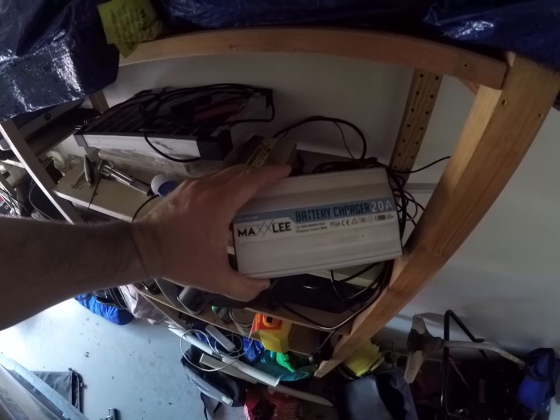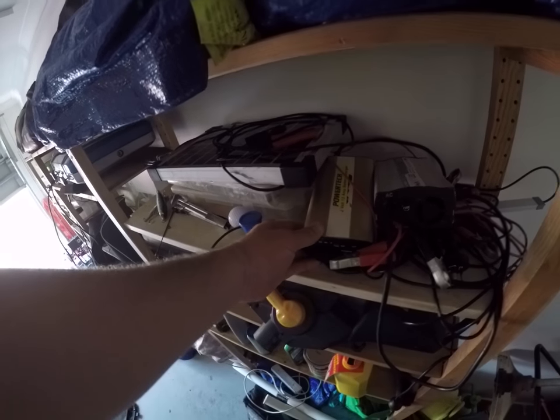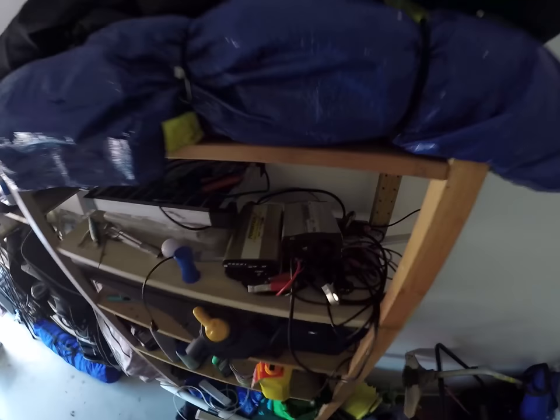I want a long, slow, easy-going charge that's not going to blow my battery. I found if I try to pump 20 amps through sealed batteries they don't last - I get a year or two out of them, they swell up. For my maintenance-style battery that can ventilate, I pump 20 amps straight into it. These battery chargers aren't expensive - this Power Tech I bought from Bias Boating in Brisbane cost me about 100 bucks and that was probably 10 years ago. The 20 amp I got off eBay for 40 bucks, had it a few years, no issues whatsoever.